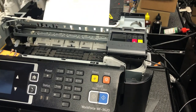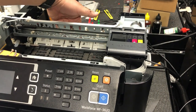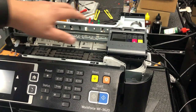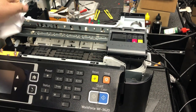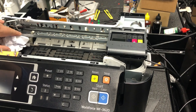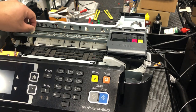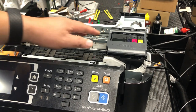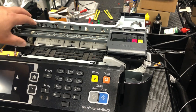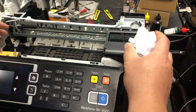We'll put a piece of paper through the roller to make sure there's no debris or obstruction stopping the paper. Especially if you print stickers, sometimes a sticker gets stuck on the wheel. The printer is also trying to move to the left — asking whether you have a piece of paper on the left that jams the movement of the print head.